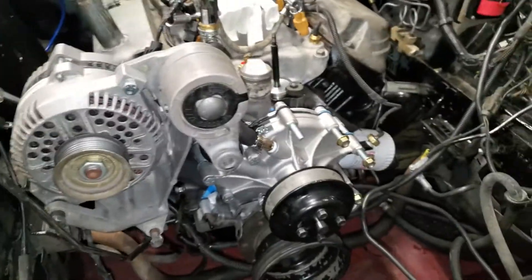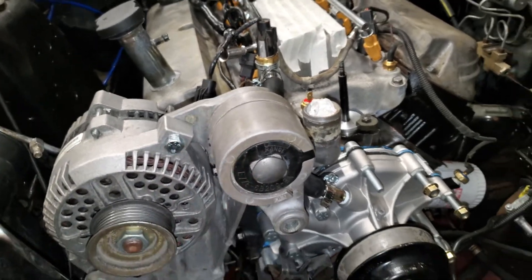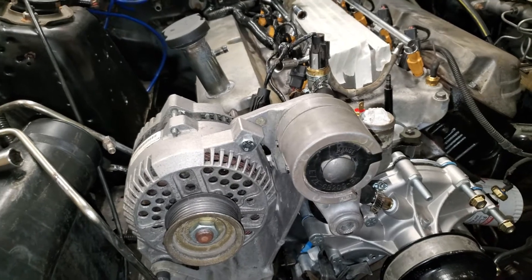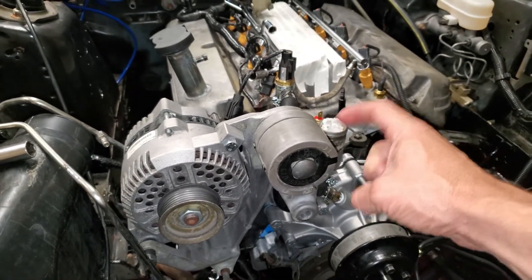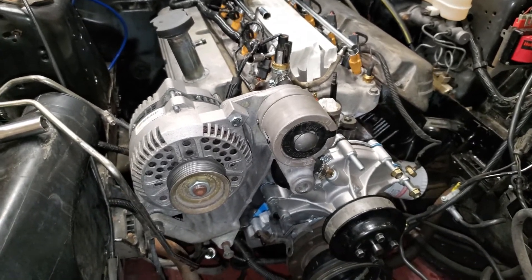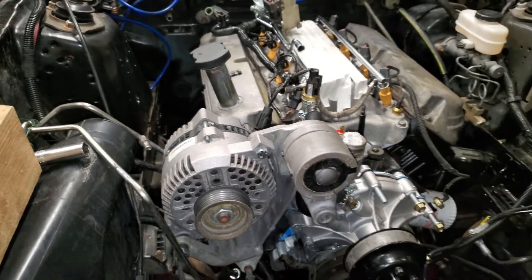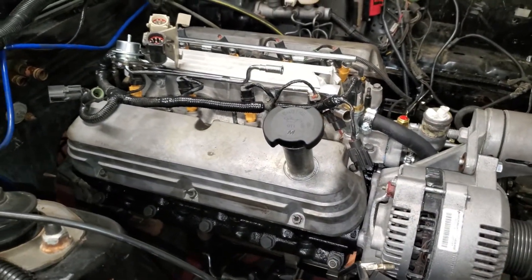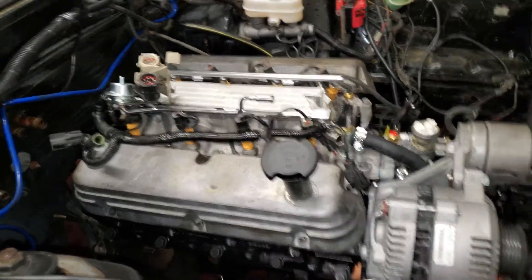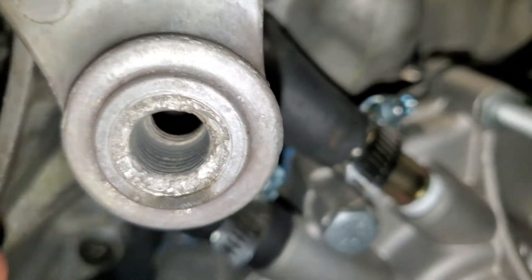I did go pick up a new tensioner today for it. Kind of irritates me — I spent a lot of time cleaning this, to find out that that nub was busted. I don't know how it was even holding together. The whole time I've had this bracket it's just been sitting in a box all dirtied up. But the whole time the pulley stayed on there. It threw me off when I went to tighten it — the bolt was loose, and when I went to tighten it up she wasn't tightening. You can see it's broke right there, and there are about two or three threads left, all the way at the back. That was a no-go for using that.